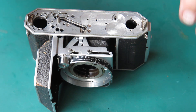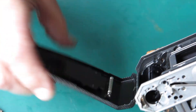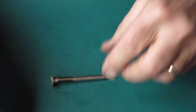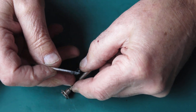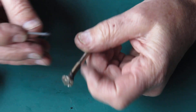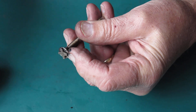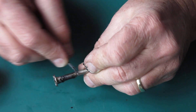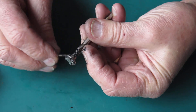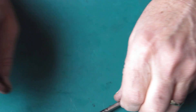The next task really is to get on to the film advance. Here I've got the take-up spool — I'll just put its metal bush in the base of the take-up spool and put that in place in the back of the camera. The shaft I normally lubricate with graphite grease, because I like the smooth feel of this grease as it works and its stickiness — it sticks to the shaft and is in no danger of squeezing out and leaving it unlubricated. I'll run some into the spring itself. Yeah, that moves smoothly — that'll do nicely.